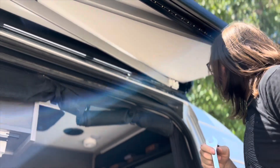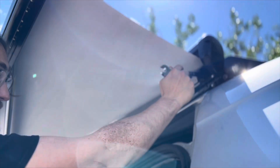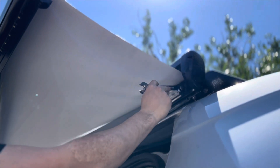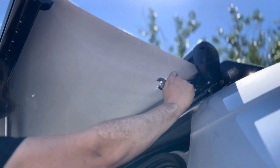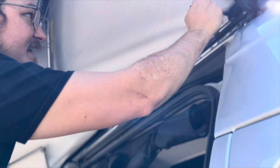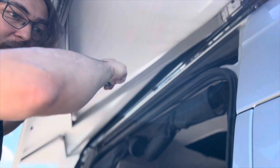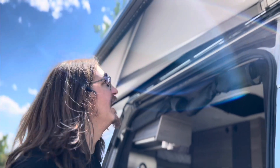Another thing to check while adjusting the pitch: this is a 17 millimeter bolt and these like to wiggle loose over time, especially as you're driving down the road and getting more miles — it just walks itself loose. You'll know you want to adjust this because this elbow can actually hang low. Lift up the elbow and tighten this bolt as tight as it can go — that's going to keep the elbow from sagging and prevent trouble closing and opening.